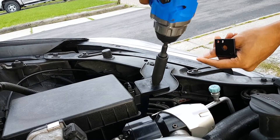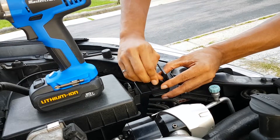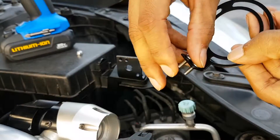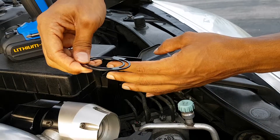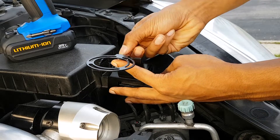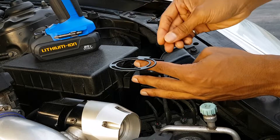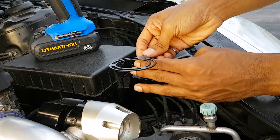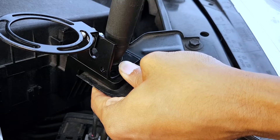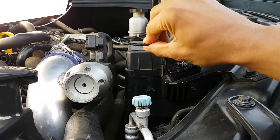Take a 10-millimeter socket to remove the existing bolt, and here's our bent bracket that we're going to put in. First, hand-thread this on. Because there's going to be a lot of vibration, I decided to use lock nuts and 8-32 screws. Put that through there, take the lock nut, and go back and forth until there's no play. If you take a look at the structure, that's solid — that's called engineering, folks.